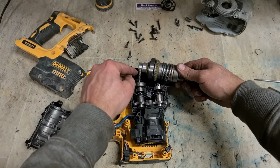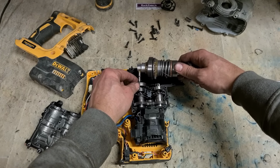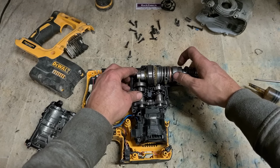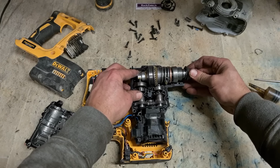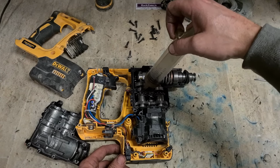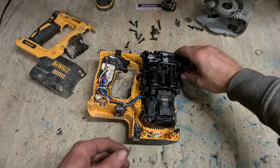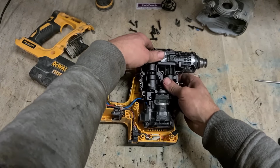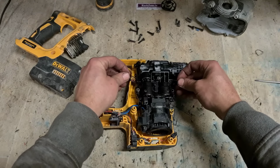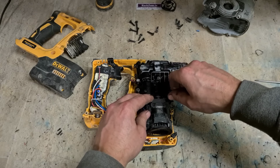And again, make sure your spring and washer are on this wee con rod. Just this wee needle roller at the back. Push and drop them on. And then give everything a good tasty grease. That should hopefully be the problem solved. It's quite a common one, I see it quite a bit.